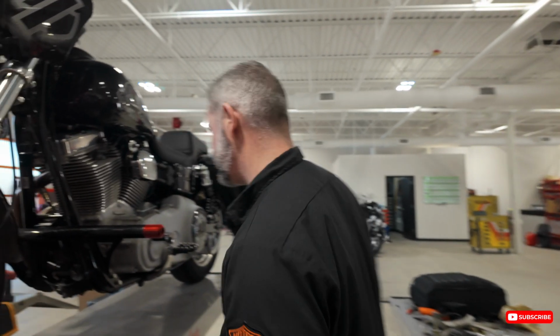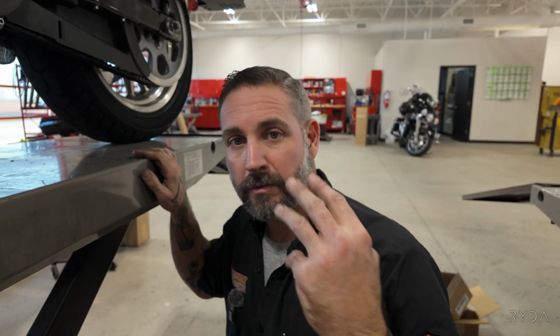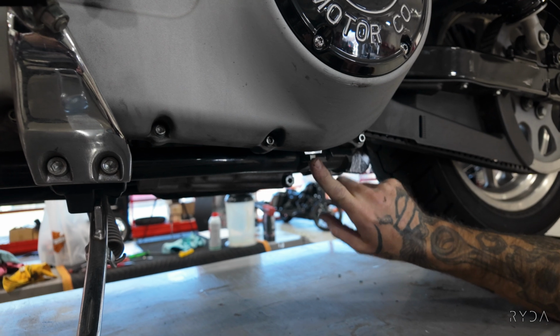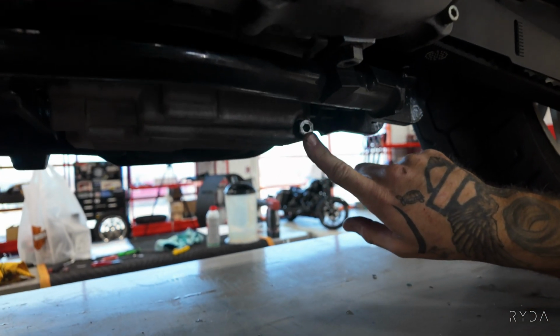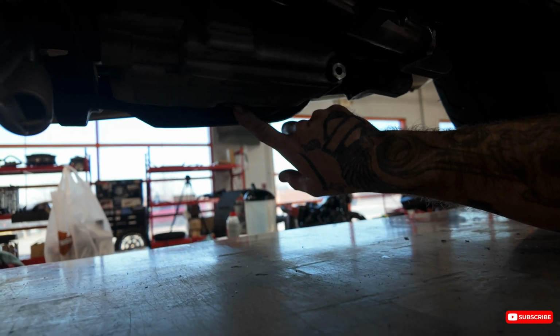Come on over here, guys. So on a Dyna, you have 3 drain plugs. 3 holes, 3 drain plugs. Engine, transmission, primary. Now, if you don't know where those are at, I'm sure there are other videos out there that show you, but today I'm gonna show you because this is coming from a credible source, not some Yahoo that thought he knows what he was talking about. So, right here you have your primary. Right here you have your engine. And then right there you have your transmission.